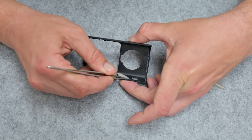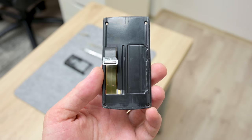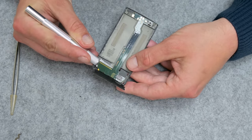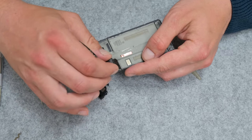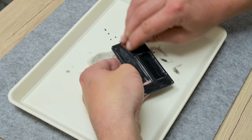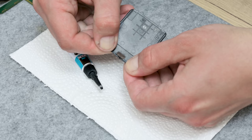So I decided to make some modifications. Using tweezers, I remove all the buttons from the case — the buttons are still shiny and fine. Except the case, the slider is not looking good either — the paint is scratched and faded. But the slider is made from metal so things are easier. Using a flat scalpel, I carefully remove the flex cable from the slider. Then using 800-grit sandpaper and water, I sand the case to remove layers of paint and make the surface smooth. I also found a small crack on the battery cover, which I fixed with superglue.